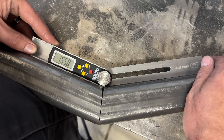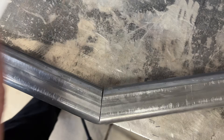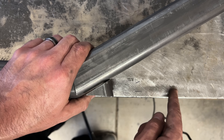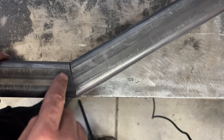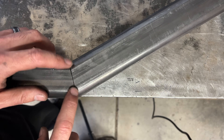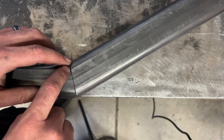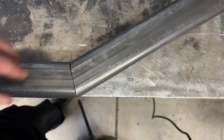155 — I'll take it. The shot is just to show that the angle of the piece that I removed equals the amount that the bar had to bend up. This is quarter-inch thick metal, so in order to get good penetration all the way to the center when I'm welding this back together, I have to bevel these edges.